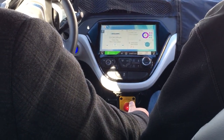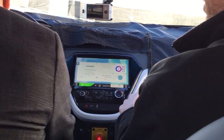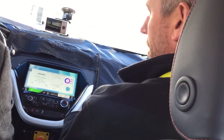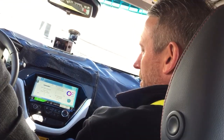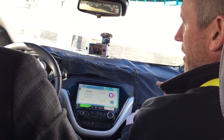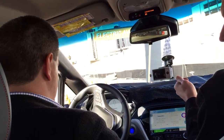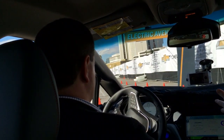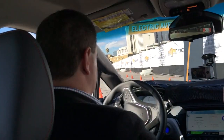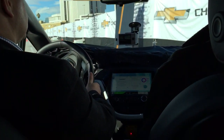So now that's one-pedal driving. Alternatively, you can go into D and lift your foot off the brake and pull this paddle behind the steering wheel — that will also eliminate creep. When you hold the paddle and let it go, the car will go forward. So you have several options — there are three options. I prefer the L. One-pedal driving, away we go!